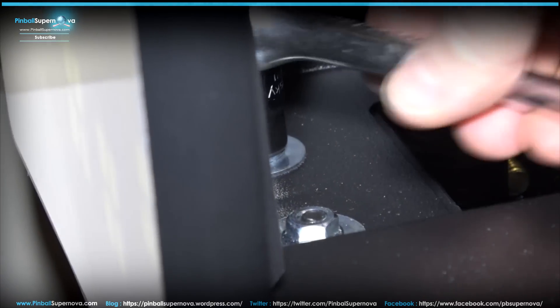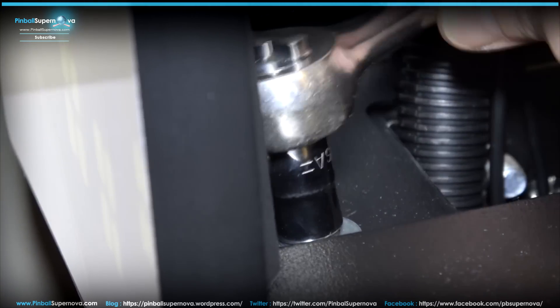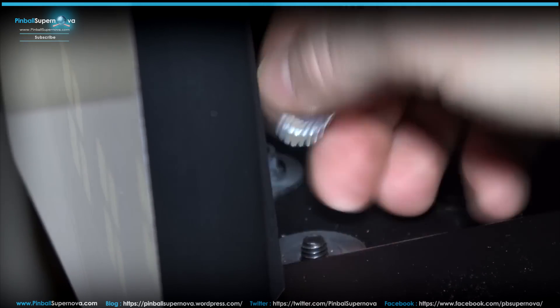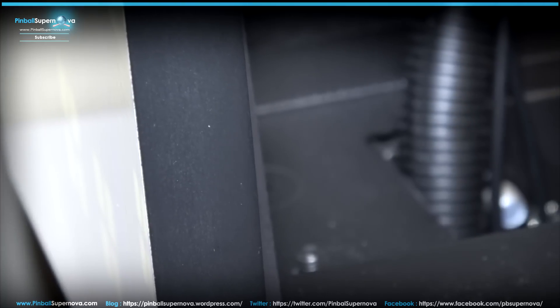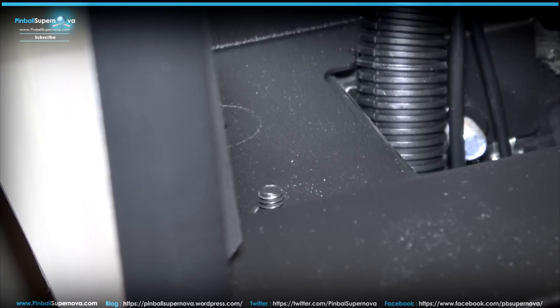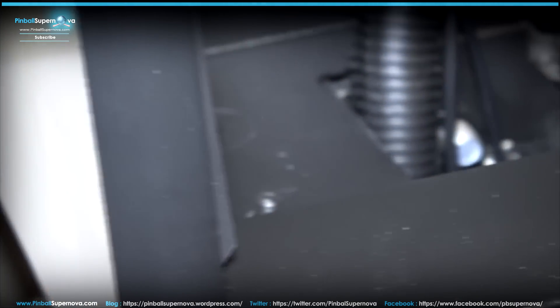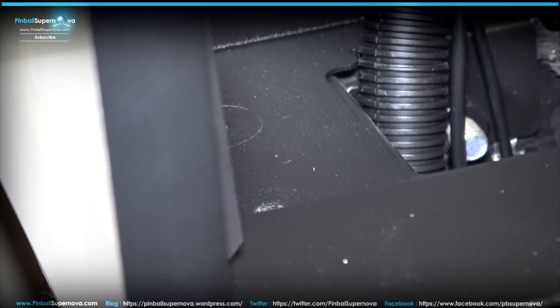On the left-hand side of the cabinet, we do the same thing — loosen the two nuts in the back box with the ratchet, then hand-tighten them off. You can only really see one nut, but go under the hinge and jiggle it a little to hand-tighten them out. Then just push the rail down.